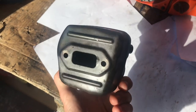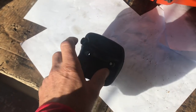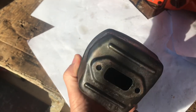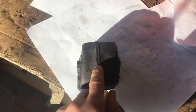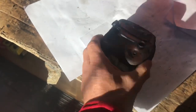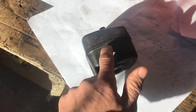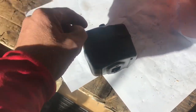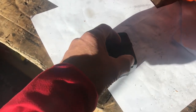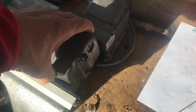The idea is to take the baffle out internally and then put a bigger hole in there — and that's about it. These look like they're somehow welded, so I'm tempted to just cut that side or that side. I feel the baffle in there is sitting on top. If I cut it there the baffle will come out with that bit; if I cut it the other way the baffle will be stuck in there. Either way it's going to be interesting, so I'll cut along the top here first. Let's put it in the vise and get the angle grinder.